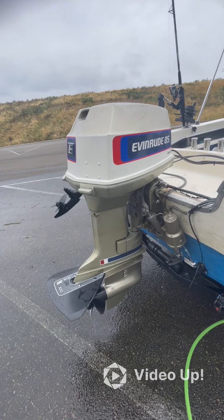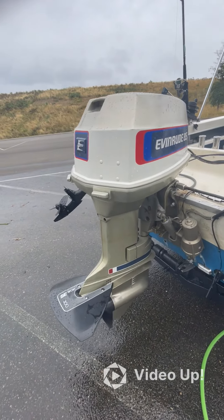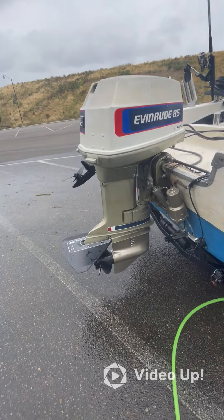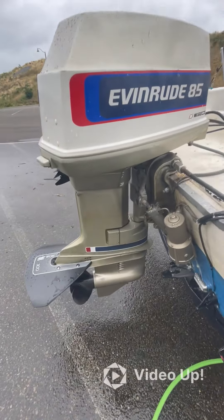This is a 1976 and as you can tell she's in pristine condition. I run her in salt water all the time, but this is how we take care of her after we're done. You're going to wash the whole external motor, but then the most important part is you've got to flush the motor, and I'll show you how to do that next.